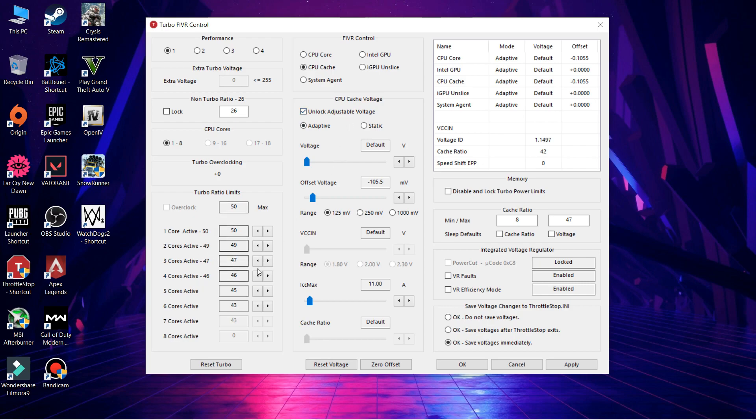On the left side you can see the per-core clock speed settings — do not mess with those unless you fully understand them, as that can crash your system. This undervolting method has worked well for me. Previously my temperatures were insanely going above 95 degrees, but now I'm able to keep them below 80 degrees. Temperatures of 75 to 80 degrees are comfortable for me.